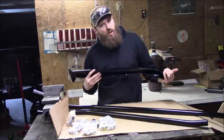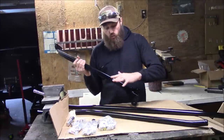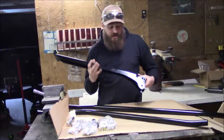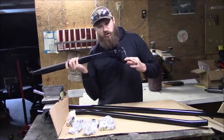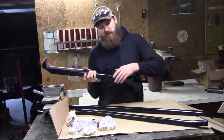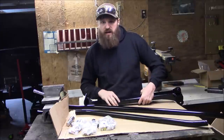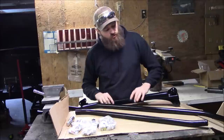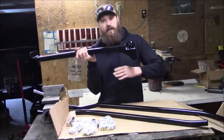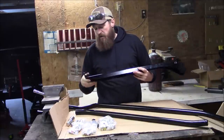Also, and this is probably the reason why I really went with this kit, is this track bar mount that comes with the kit from Iron Rock Off-Road. This is going to do two things. Number one, it's going to lower the mounting location for your track bar, which is designed to help fix steering angles after you lift a vehicle. When you lift a vehicle, it puts a more extreme angle on the track bar, which can cause problems including something called bump steer.